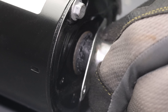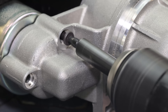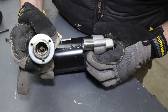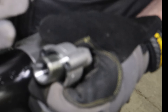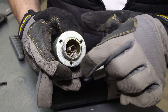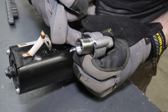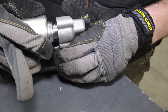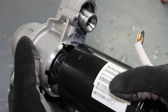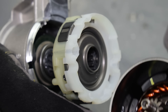This is the solenoid — it's literally a solenoid with a plunger and a spring inside of an electromagnet. It's just a coil; it energizes, creates a magnetic field, and pulls this piston into the cylinder, just like that. I don't think I've ever taken one of these apart before. There's a spiral gear and a fork too. I hope I can put this back together.